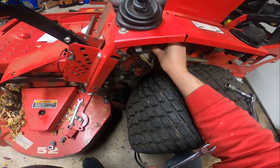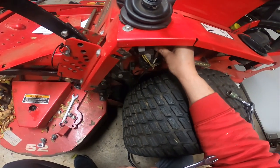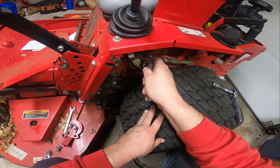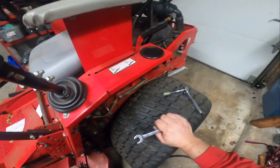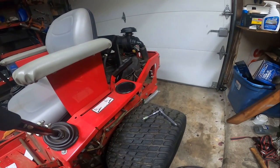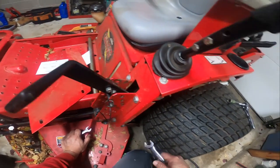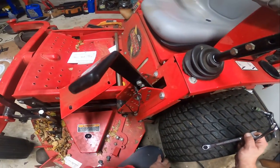After looking at the manual a little bit further, I'm like, what in the world? I don't see that. I looked through the parts manual, and as I was looking through it, I noticed the adjustment up underneath the cover here. So that's very easy to get to. I'm going to have to go through and edit all of my videos so I can put this up there. How simple is that? Three 13-millimeter bolts. You adjust your tracking levers. No need to get in there and fiddle with the bottom half here, the bottom bell housing.